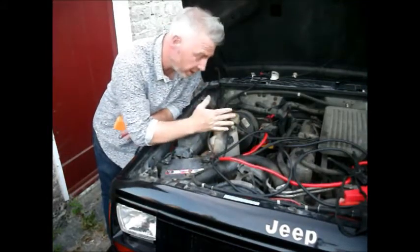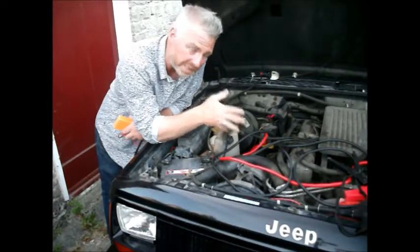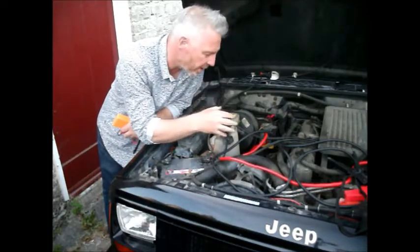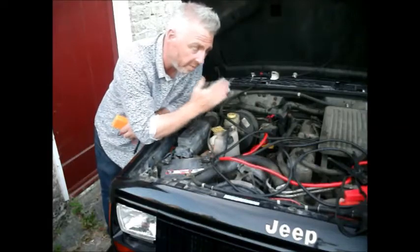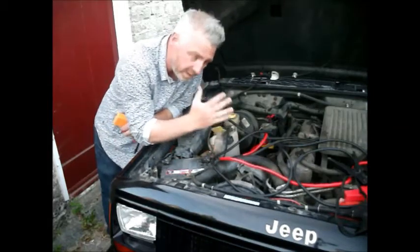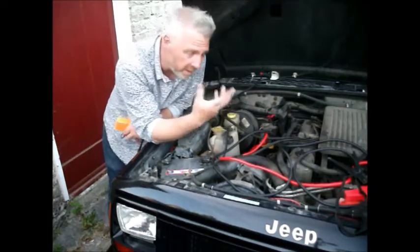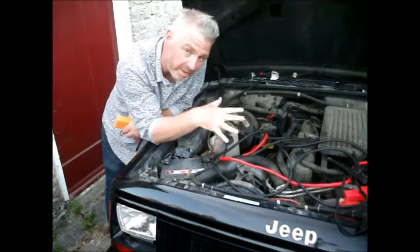So I know that it cuts out the power to the starter motor, so when the alarm's not set, it won't actually turn over. But I've got to find out if it does anything else, because I suspect, a car of this age, it's likely that it could cut the power off to the fuel pump, and it may well also cut off the power to part of the ECU or the ignition coil. So essentially, it's going to prevent power getting to certain systems on the car.